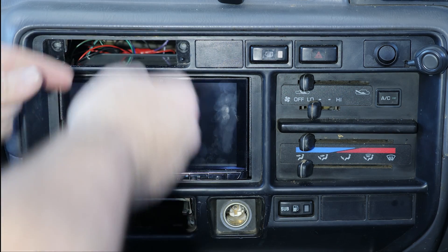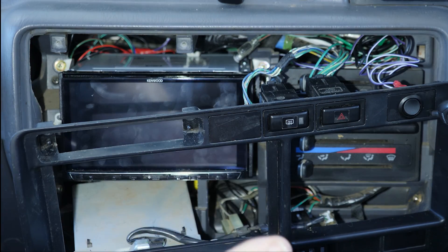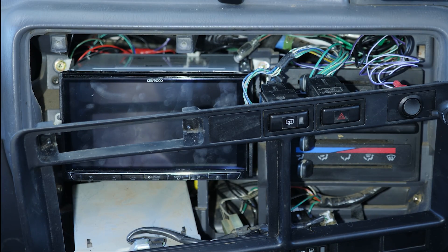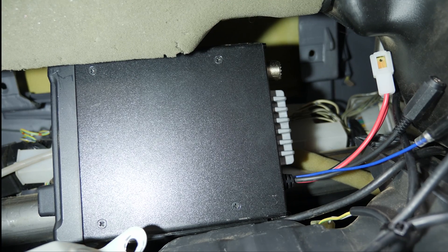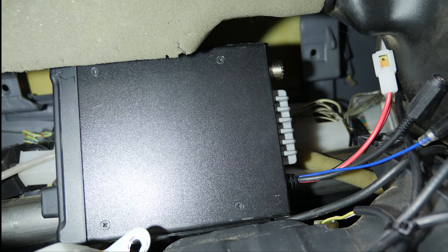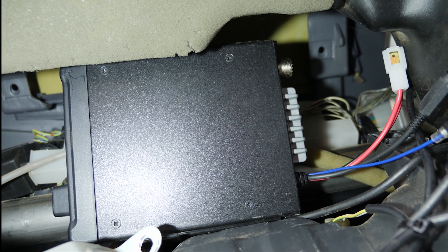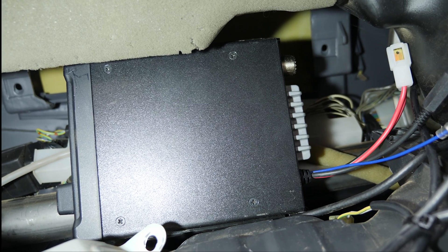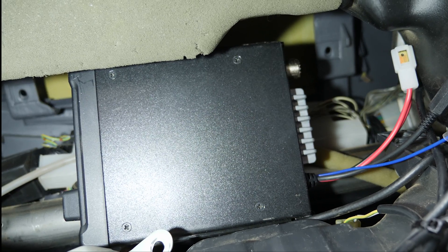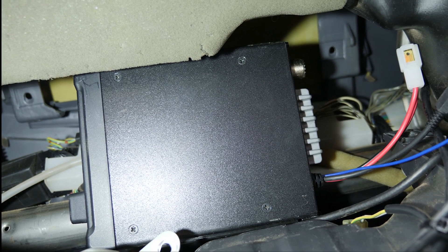This panel should pull out now. We just need to disconnect all the wires. I've mounted the unit under the dash here — this is under the glove box side — and there's a beam running across the top that I've managed to screw the bracket to. When you're deciding where to put your radio, try and put it up high. Don't go for an easy spot like under a seat.